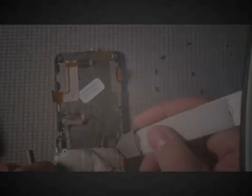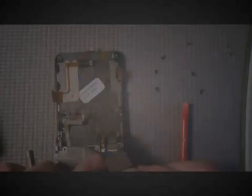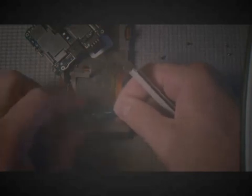and lift up the little heat tape on here. There are 2 more ribbon cables that you have to unlatch and then slide out. They pull out really easily. And there's the bottom circuit board that also has 1 ribbon cable in it, so I unlatched that. I removed the tape that's holding the ribbon cable to the latch. You can see me take that off right here. And then once that tape is off, it slides out like any normal ribbon cable.